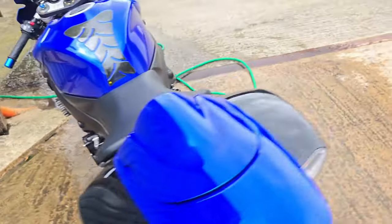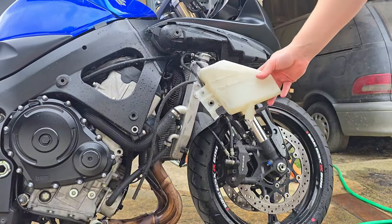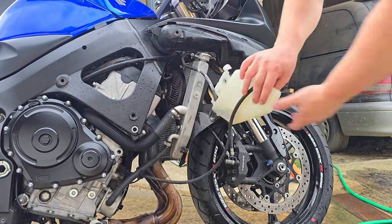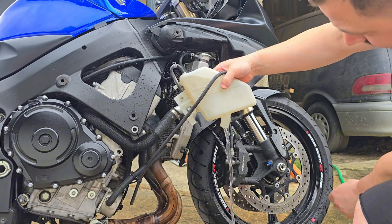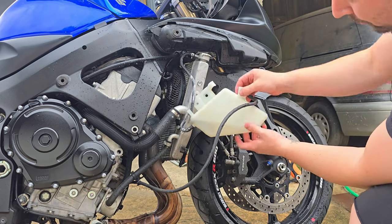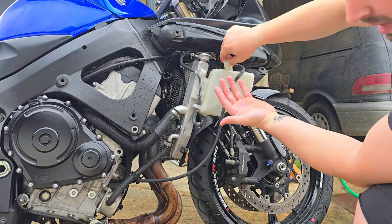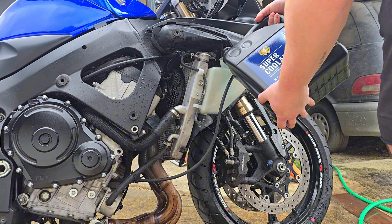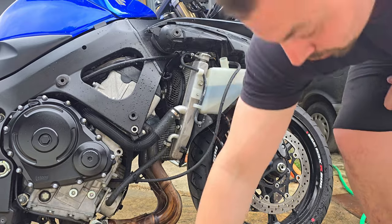We need to begin taking the water pump off next, but first I need to clean out the expansion bottle. On the back you can see the low and full level markings, so just keep it just below full. Flush it out once more until it looks clear. Then put some fresh coolant into this bottle — this is the blue Suzuki coolant going in to replace the green stuff. Check the level — perfect, just about on full. The bike's back on its paddock stand.